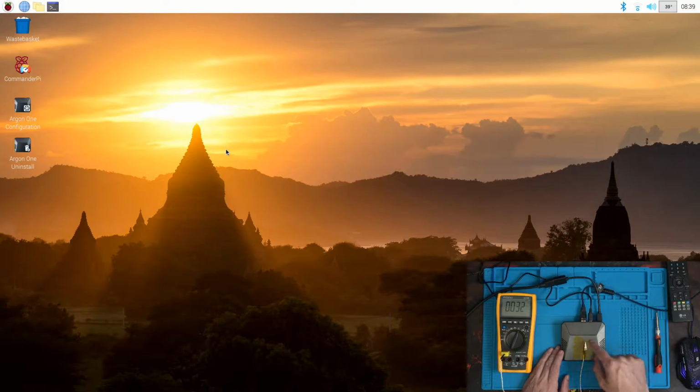Now, I will be running a stress test on this called Stressberry. What it does is for about 2.5 minutes, it checks for idle temperatures and draws a graph, and then for about 5 minutes, it stresses the CPU out, hence the name, and benchmarks it so that you know the temperatures for that particular speed. So for about 5 minutes, it does it at full whack at 2000 megahertz or 2 gigahertz. And then it cools down again for about 2.5 minutes.